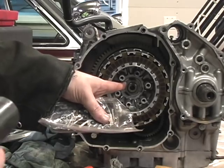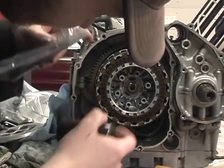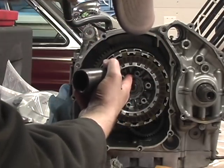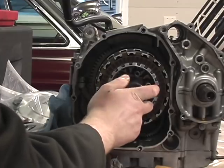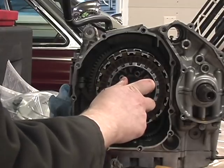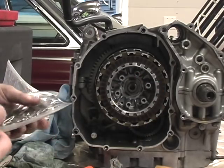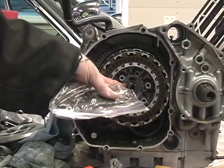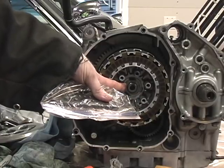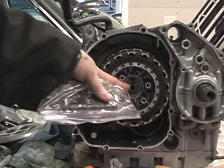This nut — the clutch basket nut — is 27mm. You wouldn't need a deep well but you'd get away with it. There's a lock washer there; you don't want to bend the tabs up. Most of the time I get away with not bending the tabs. I'm going to use the impact wrench because it's easier. Otherwise you'd need to find a way to hold it — this is, I want to say, 52 foot-pounds; don't quote me, I'll give you a torque spec when I put it back together. It's on there pretty tight, so you might need somebody to hold it if you don't have impact tools.